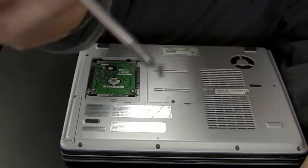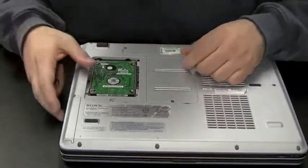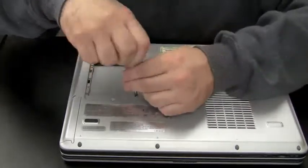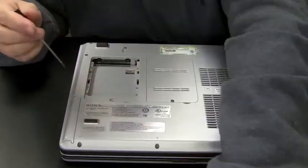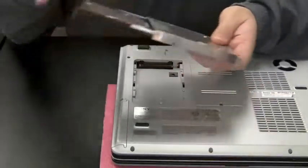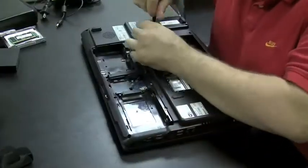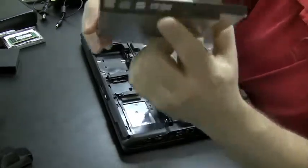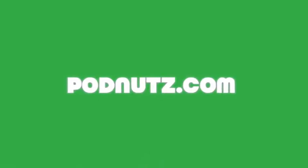Another laptop I'm not a big fan of because it gets a little intricate is the Sony Vaio. For this older model, you have to get under the hard drive to get the CD drive out. You take the hard drive cover off, then take out the four screws that hold the hard drive in — there are tiny screws that are hard to see on camera. You pull the hard drive out — it slides out and pops up — which exposes two screws that you need to unscrew to get the CD drive out. There's one, there's the other. Since there's nowhere to push the drive out from the inside, we take a paper clip, put it in the drive hole to open up the drive, and then pull it out that way.